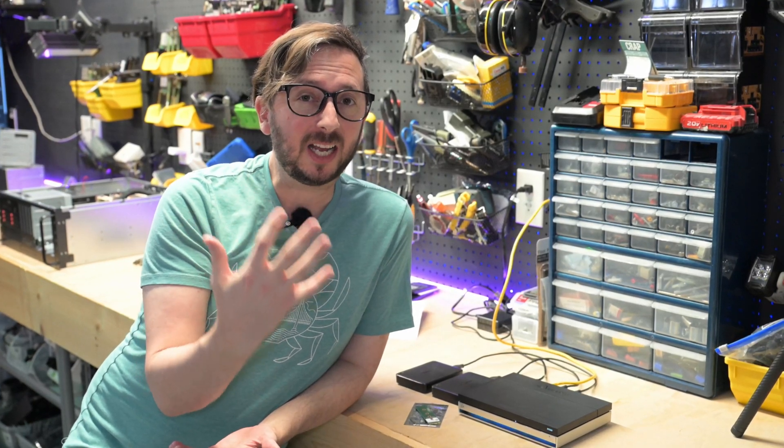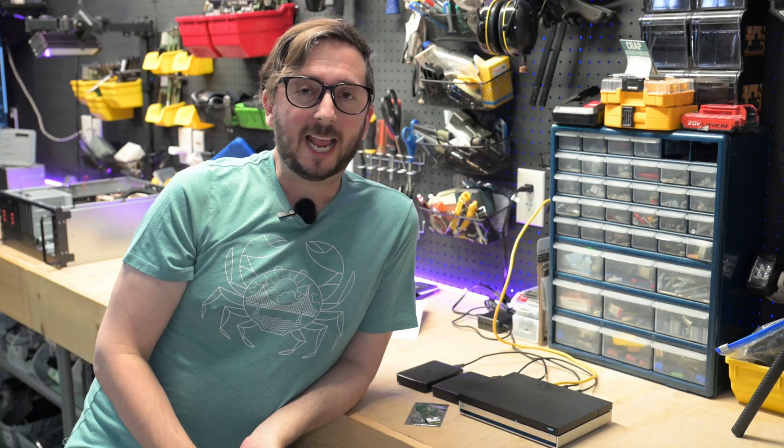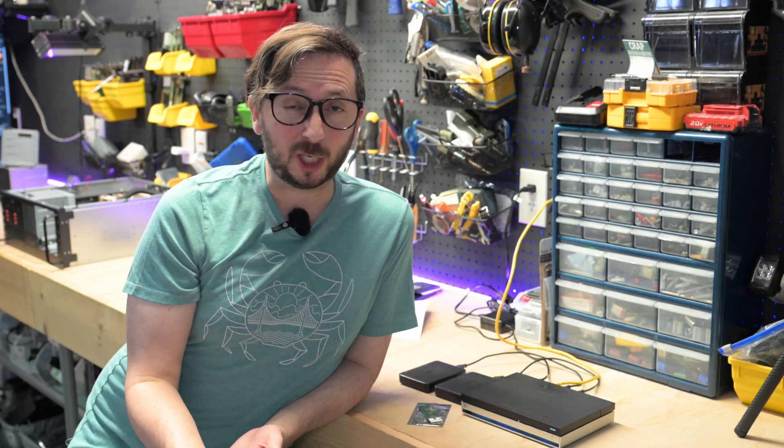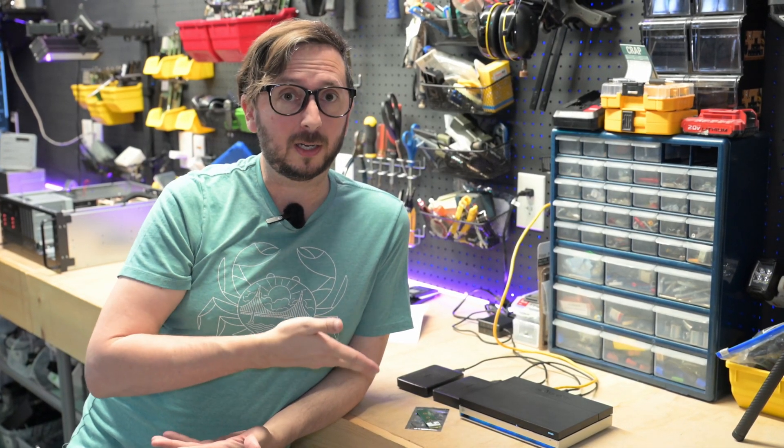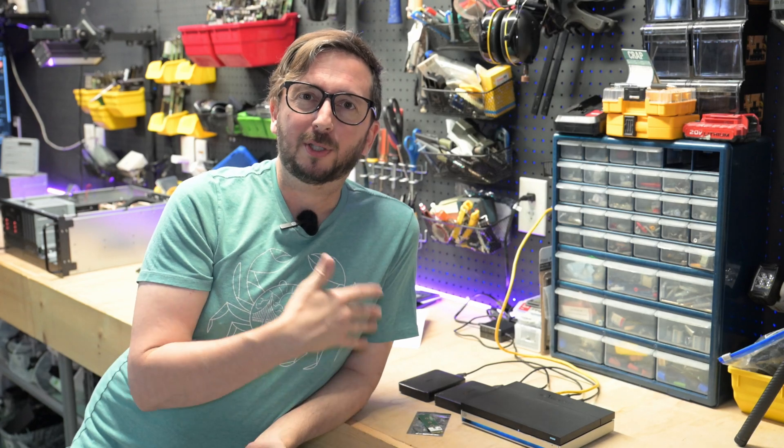Overall, I really do like the Linkstation N1 — it's a really decent piece of hardware. It does have one shortfall: having a 2.5 gigabit NIC instead of a 10 gigabit NIC is not ideal. They really should have addressed this. That said, if you're just using SSDs or lower-performance NVMes, it may not matter that much. With high-performance NVMe drives you're leaving performance on the table, but with SSDs in a mirror setup you're probably maxing out around 500 MB/s anyway, which is close to what 2.5G can push — so it's leaving a little on the table, but not a tremendous amount.